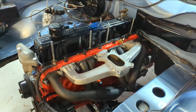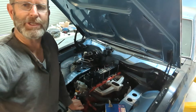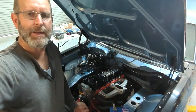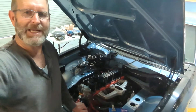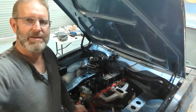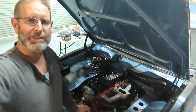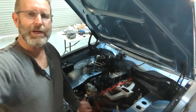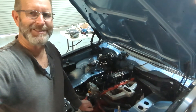There we are guys - got that manifold and extractors in there, very happy with that result. Can't wait for those other bits and pieces to come so we can give this thing a fire up. It's been a long time coming - back to that standard 173 motor with a lumpy cam and about 10 to 1 compression ratio, maybe a bit less with the eyebrows I put on the bores to clearance those big valves in this Bathurst spec head I got from HSD Head Start Development down in Victoria. Anyway, thanks for watching - keep watching this space because we're getting really close. Take care, bye for now.